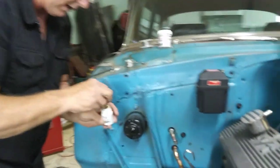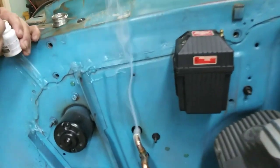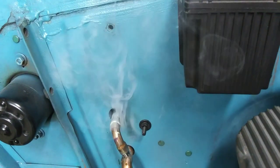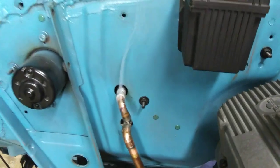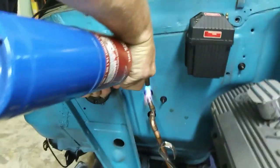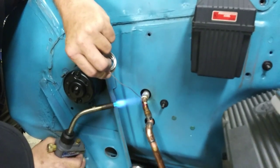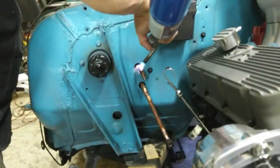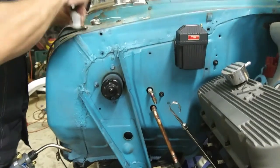I'm going to put a little bit more flux on here. As you heat it up, the flux cleans up the solder. Now look at that joint — once we started putting the flux on, which is like an acid, it just cleans it all up. All that dirt and carbon cleaned up and you can actually see the actual joint there. Looks nice and neat. Being as anal as I am, I'll put a little bit more — we probably have enough solder on there. Yeah, it's just melting beautifully in there, going on and off. You don't have to go full bore. It looks like the joint is just beautiful.